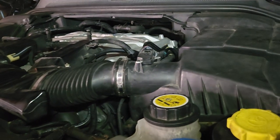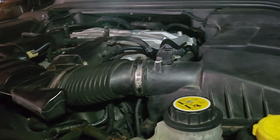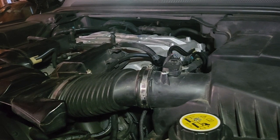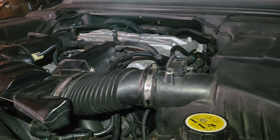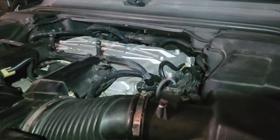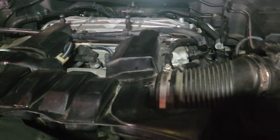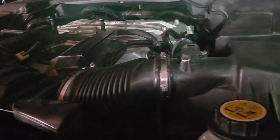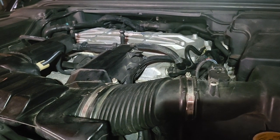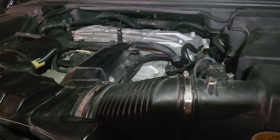I did check online and others have gone ahead and changed certain modules and sensors, but I've had similar issues with other cars and was able to do some basic troubleshooting. Long story short, I was coming up with codes P2402 to P2406. These could be specific to Land Rovers or generic to other cars as well, but basically it was coming up that the EVAP canister or purge EVAP valve high circuit — when something is 'high,' that means it has some kind of high resistance in the electrical connection.